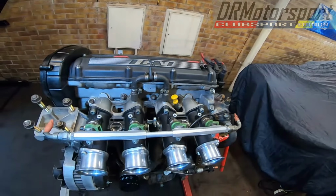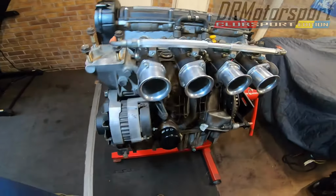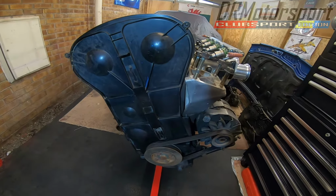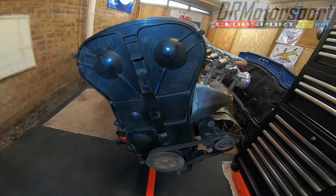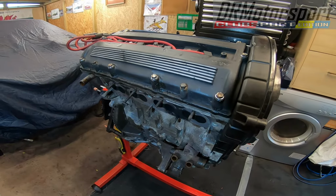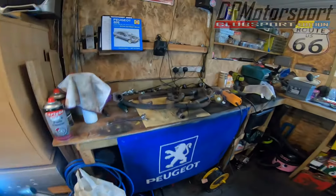The only things I'll be doing soon, once the underneath the bonnet stuff is done, I'll be removing the manifolds, the ancillaries, giving the engine a good clean out. I will be replacing the cam belt, idlers if needed, and tensioners and water pump possibly. It was rebuilt in 2017 and fitted with a high pressure fuel oil pump, so that's also very good news. I mean, look at that, the receipt package that came with the car. So it's all very encouraging.